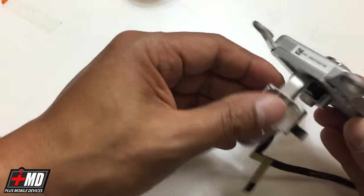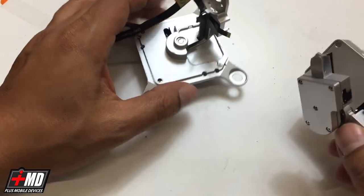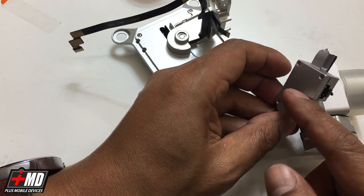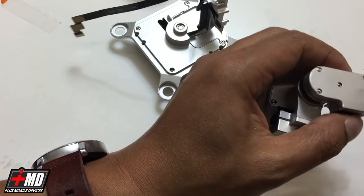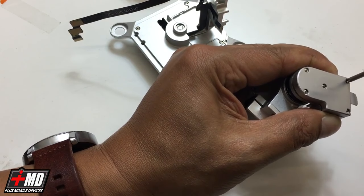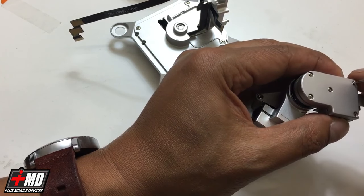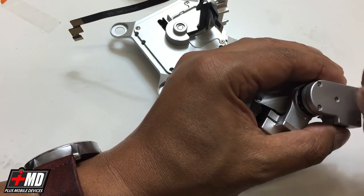Once that's nice and secure and it's freely moving, let's go ahead and work on the other yaw arm. So what we're going to do is actually take the other broken half of the yaw arm. We're going to replace the motor — the motor here is still good, and all we're replacing is the shell casing and replacing the motor into the new shell. So let's go ahead and open the yaw motor. A manual screwdriver will probably do better for this particular job.